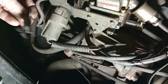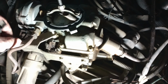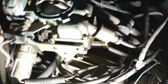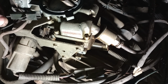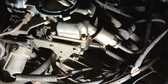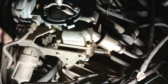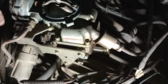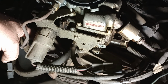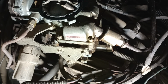And yes, you're probably looking at this wire going, well, that goes up to the choke, so it's set up for electric. Well, there's no place under this hood to plug this into. So no, I don't have an electronic choke. This is just what came on the carburetor when I got it. But it does use a thermo choke, utilizing heat off the exhaust manifold. Anyway, this line here runs all the way down to the top of the exhaust manifold, where it picks up heat and opens up the choke. So that's how that works.